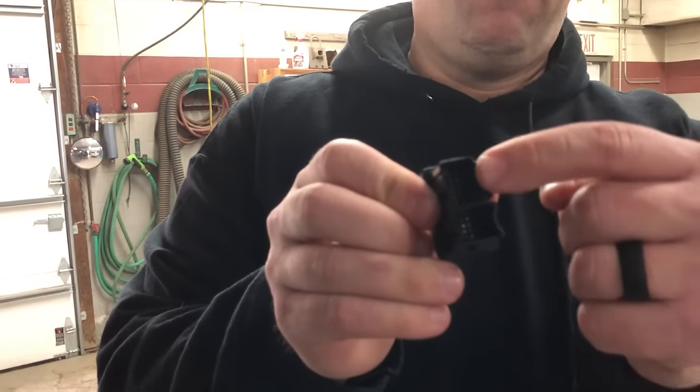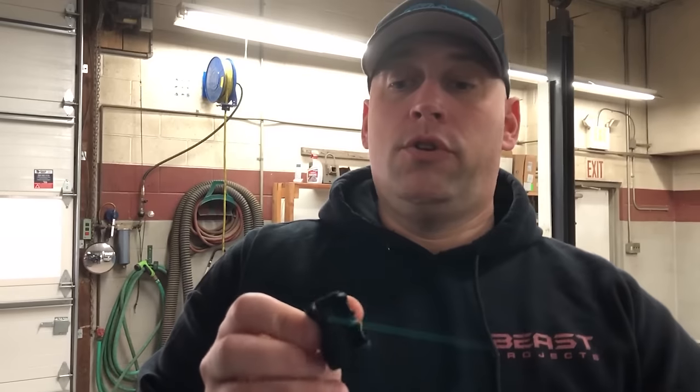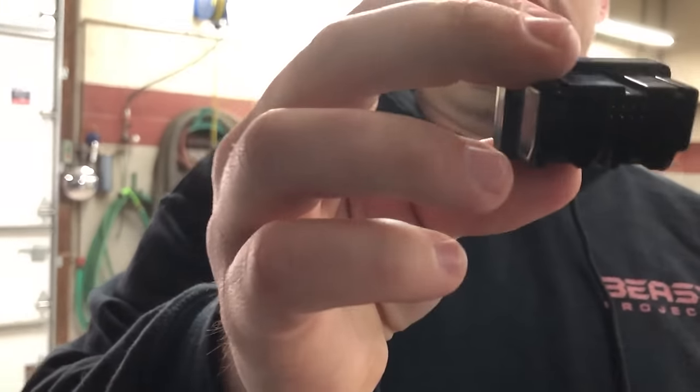Next up. Now with the 2 plugs out of the gateway module, we can install the security bypass. As you can see here, they're different sizes, so they can only go in one way. So basically, you're just gonna plug those 2 plugs right into this PowerTech security module, and then your security bypass is installed.